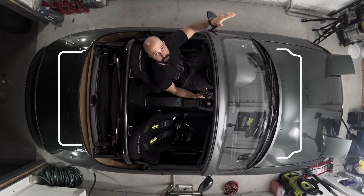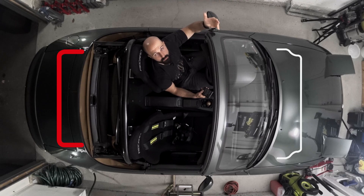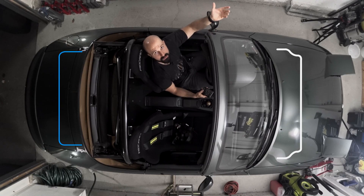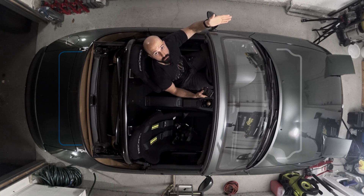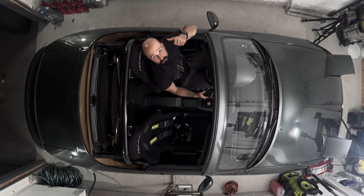Now let's say you don't change anything up front, but you make your rear bar stiffer. You reduce rear body roll and you shift the balance towards oversteer — that's when the rear steps out, like in drifting. That sounds fun, but if it's too stiff, it's going to make the car very unstable and twitchy. A softer rear bar does the opposite: more rear grip and stability, reducing oversteer. In a front-wheel drive car, you usually have too much understeer, so you'd throw on a stiffer rear bar to help it rotate better and add a little oversteer.